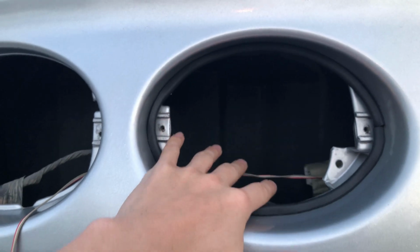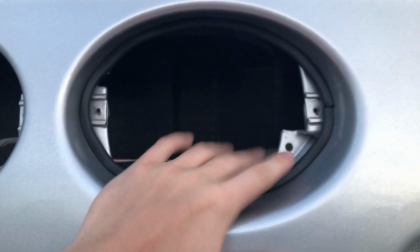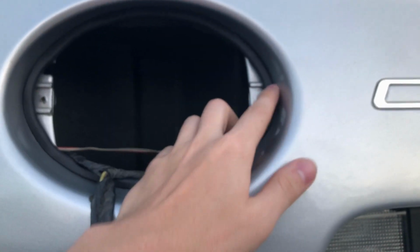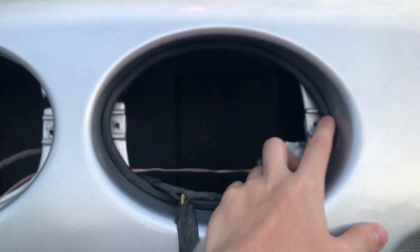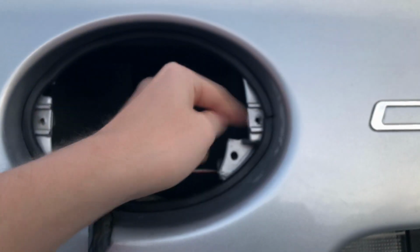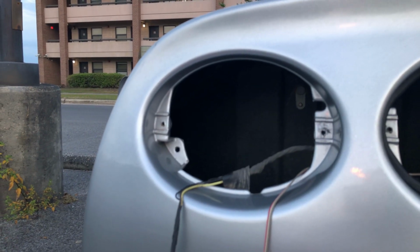And there we have it, guys. Super easy. It took me like 30 seconds. You just rip it in half and then cut it to length. Lay it along the inner side of the taillight housing, like I said. You're going to wind up with a little tail if you cut it with a little bit to spare. Just go ahead and chop that off right there and then you're good to go on that one. So let's go ahead and get started on this one here.